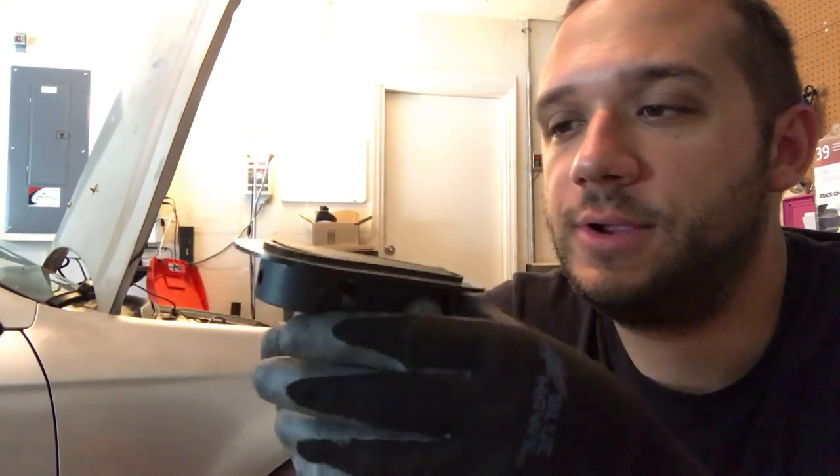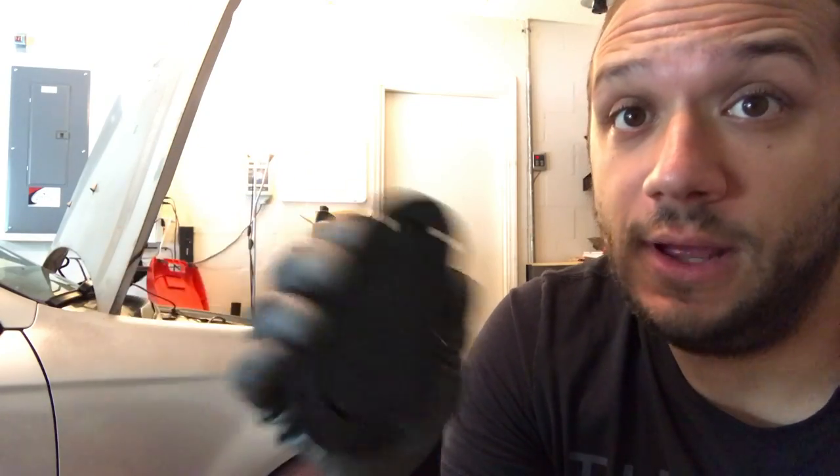Day three. The first day I did a lot of the work — cut the holes out on the hood, got things pretty much fit — but I realized that the AeroCatches I have are different than the norm. The AeroCatches I have are ones that are to be installed from the bottom and they're very flush with the hood, instead of the ones that drop in and kind of have a bump over it. On the normal kit that most guys buy it's easier to install the other way, and it's a lot cleaner on the hood because when you're cutting these holes you're not going to be perfect. I wouldn't buy these if you're a DIY home mechanic just trying to do a cool mod. I installed these the right way from the bottom up. I did the one on the right side already and I'm going to work on this one now and show you guys how to install it from the bottom up.